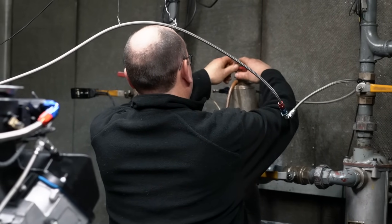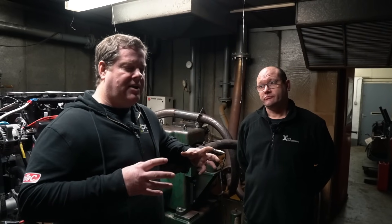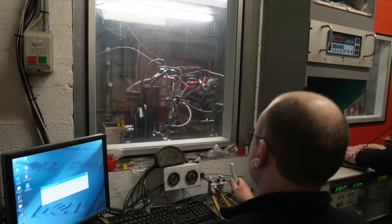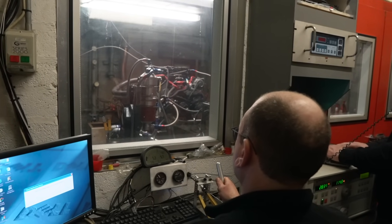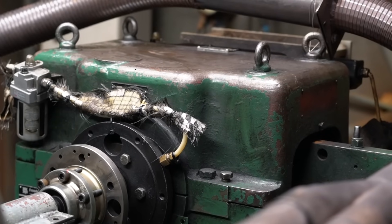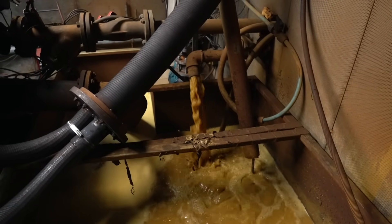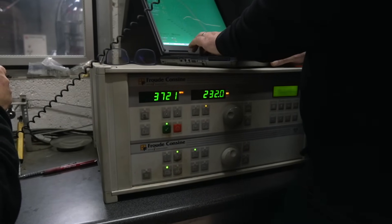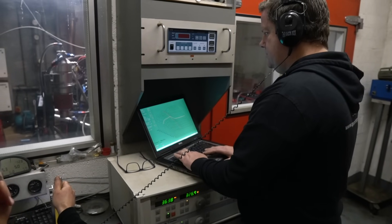This dyno allows the engine to start, run, and Paul can control the engine speed. We can also do power tests and measure the horsepower and torque for final tuning. This dyno is basically a massive water brake that limits the load and engine speed. The dyno speed can be set at different RPM points, and then on the MoTeC we can go to different RPM and load points and map every individual part of the engine settings - allowing a really good job under the most extreme conditions the engine will be under.